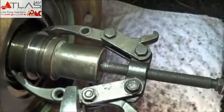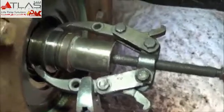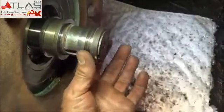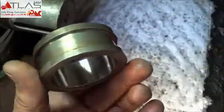I already cracked it and it popped right off a little bit, moved a little bit. I was going to pull it all the way off, then I'll take the new one, heat it up, and slide it right on. There we go — there is the wear sleeve and it's got a heck of a groove in it. Big time. And here's the collar — it just slides on first so you can grab on. It's a great design.